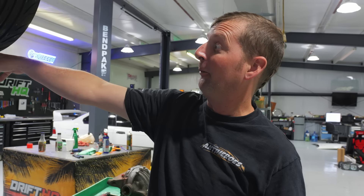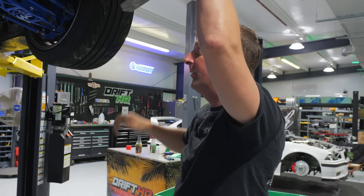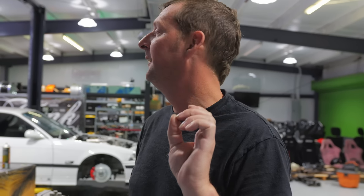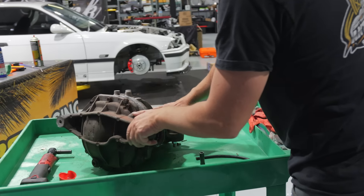We're back from vacation and we're going to be working on Tyrone, our green E92 2JZ DCT swap. We've been consistently blowing axles - Duarte's been blowing axles - and then we upgraded axles, and then we blew output shafts. We're snapping output shafts like it's our job.